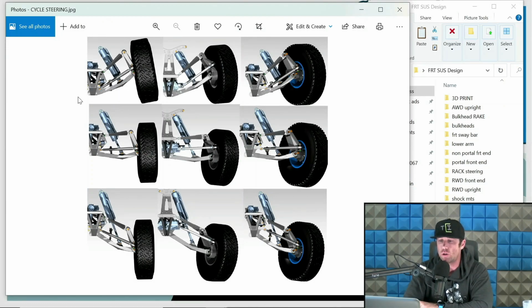Metal-to-metal can also be used to denote the measurement of the shock stroke length in the system. So, for example, I'll set a lot of trucks up like the ones you see here. They're right around 24.5 inches of metal-to-metal travel, and they will be bumped and strapped at usable 23 and change, or 24 if we're edging it close to that metal-to-metal zone. So those two numbers are very important. Usable is the most important, and you need to understand the difference between those two.